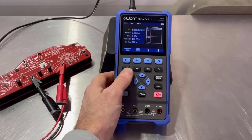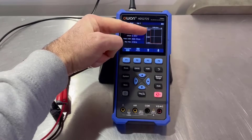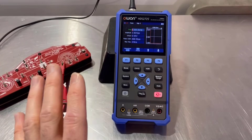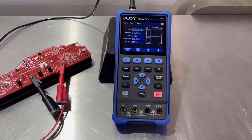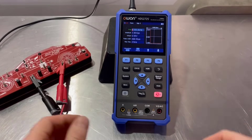If we just hit mode again, it goes to the signal generator. The voltages don't really hit high enough to be really useful for automotive testing. However, that's not to say it's completely useless — you could use it on an inductive kind of speed sensor with an AC sine wave. But again, it's not something I would buy this for.